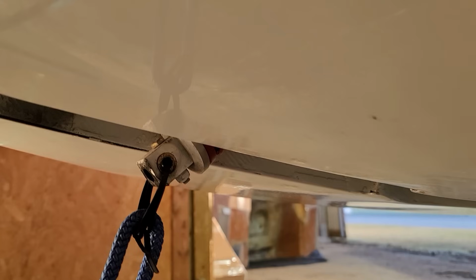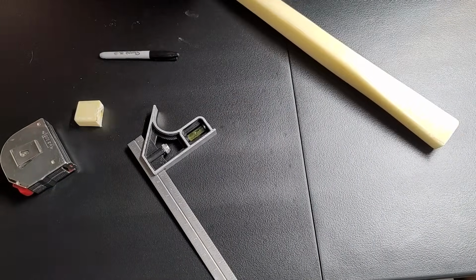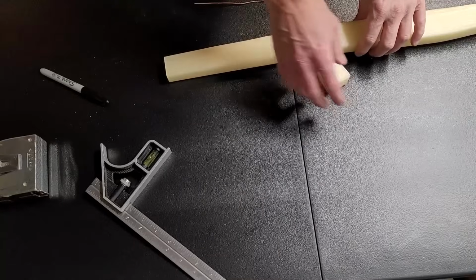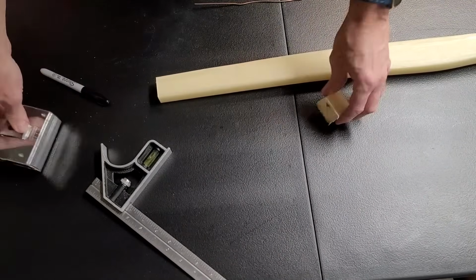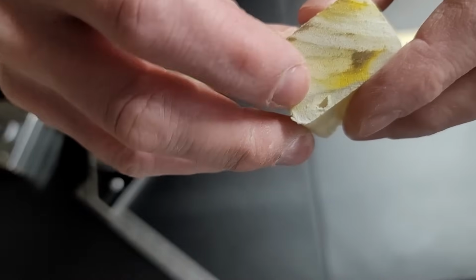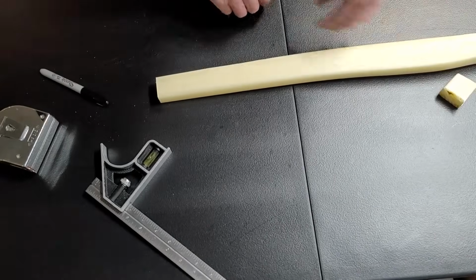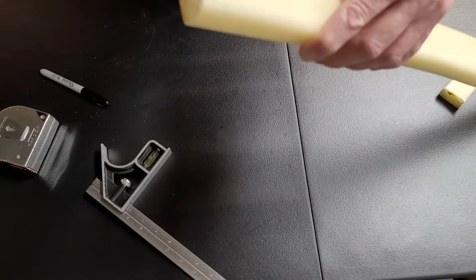The first thing I ordered was a brand new strut. I got the strut, and it needs to be formed and cut to size because it's a universal strut for several different aircraft, and I got to work. So I have cut the strut to length, and when I did, I had a look at the offcut, and there was a hole showing a void right there, and you can see the void carried through right to the very end there. And I thought, wow, that void is significant.